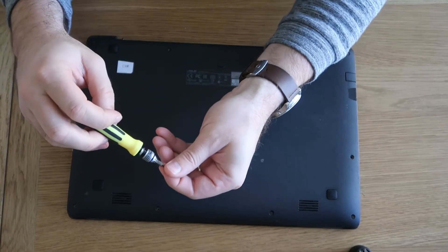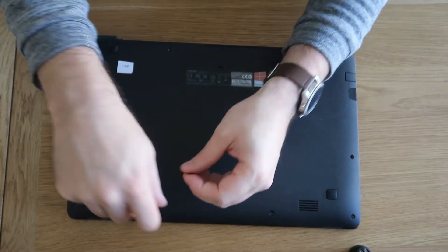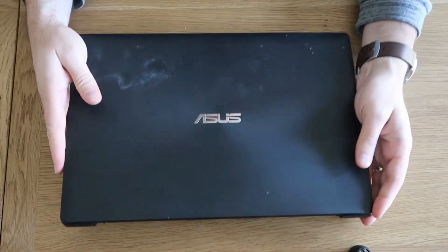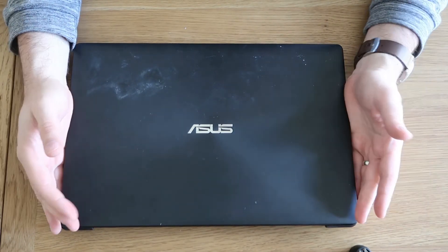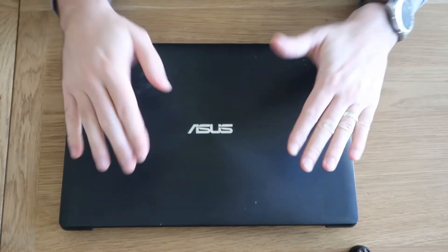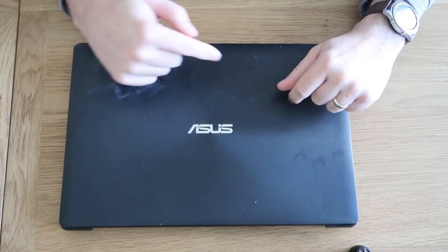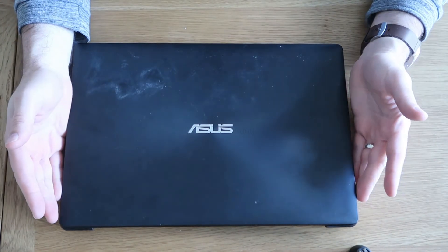And two to go — and then we're there. Last one. And that's it. So that's our battery replaced in this laptop. Just to recap: undo the bottom screws, pry around the edge, lift the keyboard out slightly, detach the keyboard ribbon cable, detach the trackpad ribbon cable, lift the whole palm rest out, four screws, lift the battery out, and then reverse to put it all back together. It's as quick and easy as that.